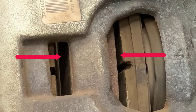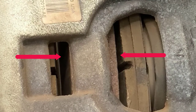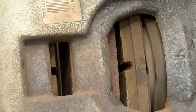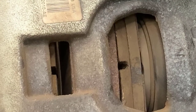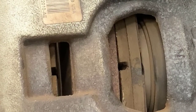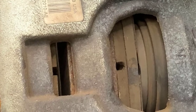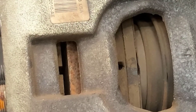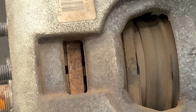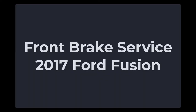You can see a large gap between the brake pads and the rotor surface. I need to pump the brake pedal until the caliper piston pushes all those parts together — if this step is not done you will not have any brakes when you first start it. You can see as I'm pumping the brake pedal the caliper piston pushes out, and you can even see it going back a little bit — that's the square-cut O-ring pulling it back. I'm going to pump the brake pedal until I have a firm pedal, and that's it — that's how you do a brake job on a Ford front-wheel drive car.